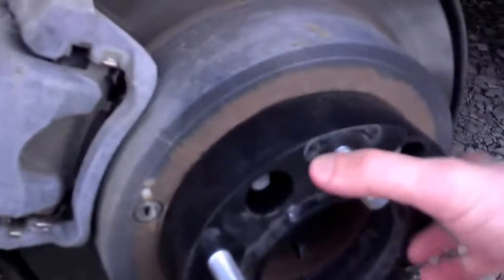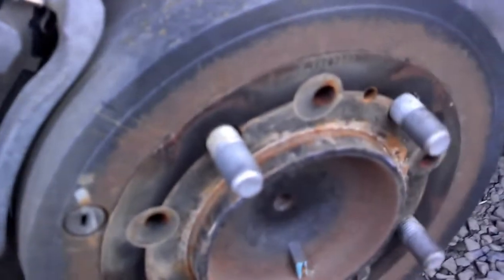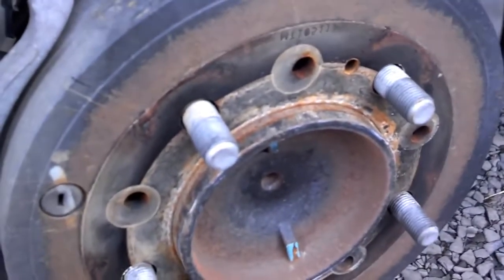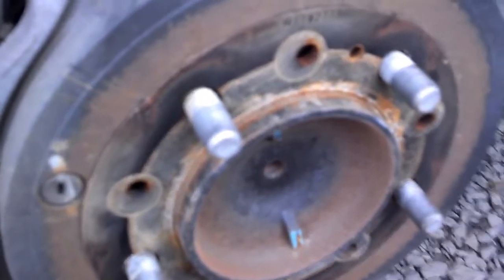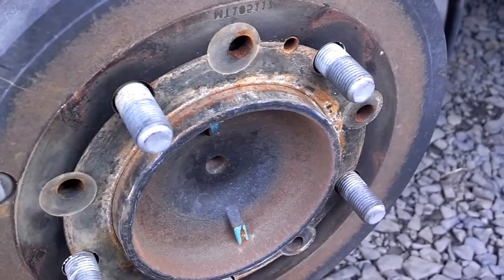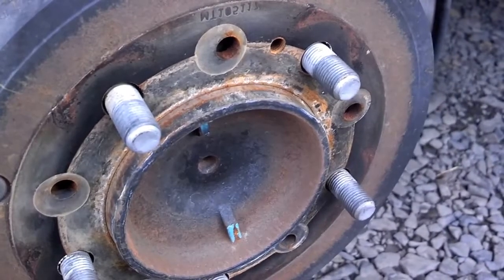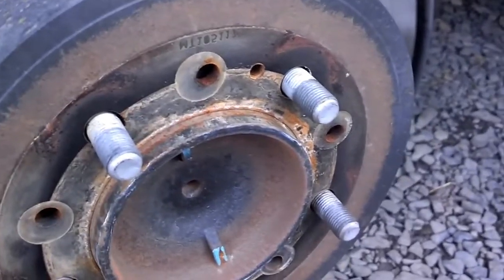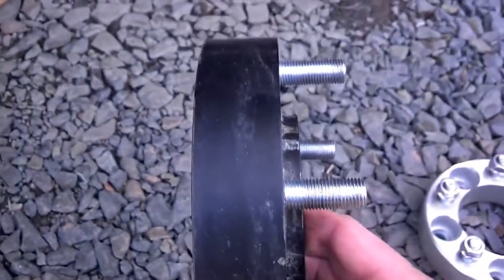A little bit about safety. Are spacers safe? Well, there are two types of spacers. This kind that bolts onto the drum and then you bolt your wheel on. And then the other kind is just a thin metal plate that would space things out — a quarter inch, half inch, something like that. Those are supposedly very unsafe. It puts too much stress on the end of the lug, and sometimes you can't get enough thread engagement. So you've got to be very careful with those. Really what you want are ones that bolt on and then you bolt the wheel to them.